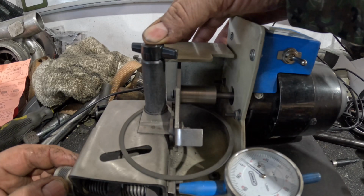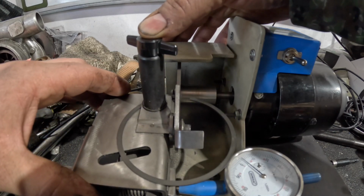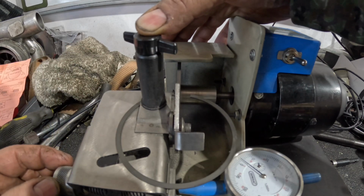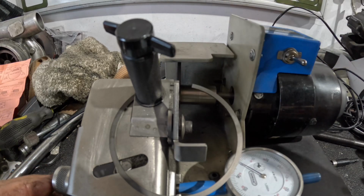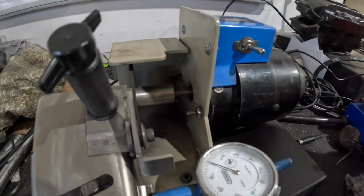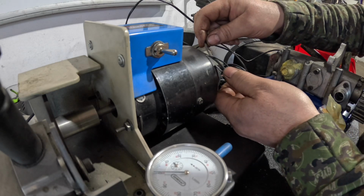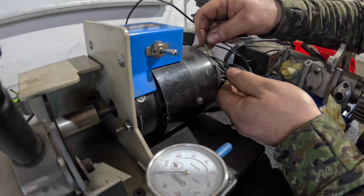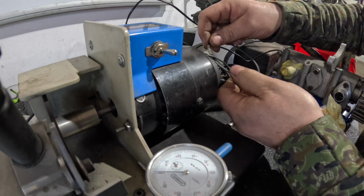And then I want the finish on the ring really smooth, so on the final cut we just bring it away from the stone very, very gently, but then before it gets to the end just back the wheel off so it doesn't drag it across the sharp part of the stone. And then very carefully on this part of the ring file just deburr the flats. And I'm putting no pressure on that at all really, as you can hear. I'm just looking for it just to polish that edge off.